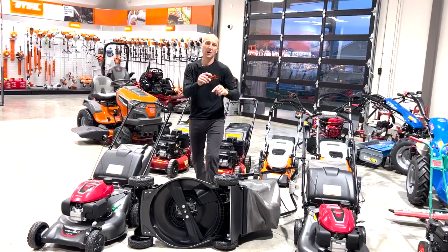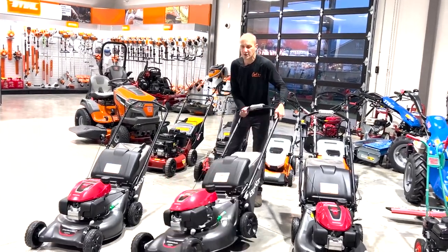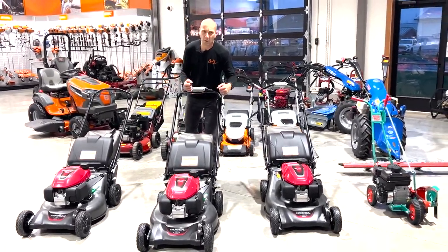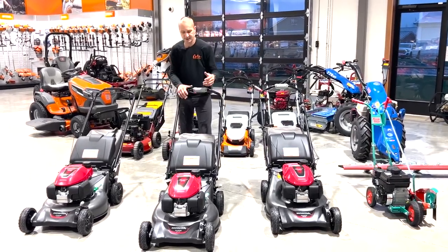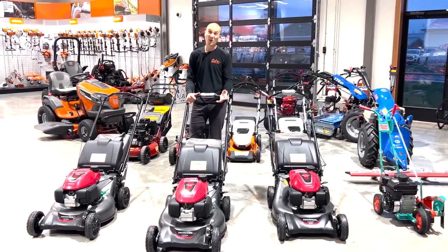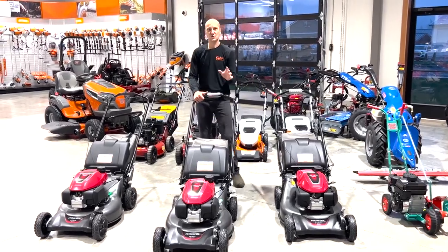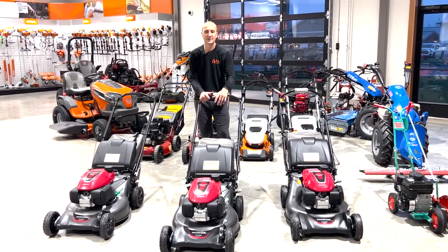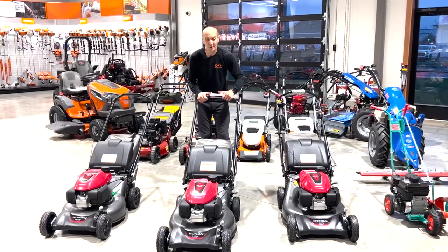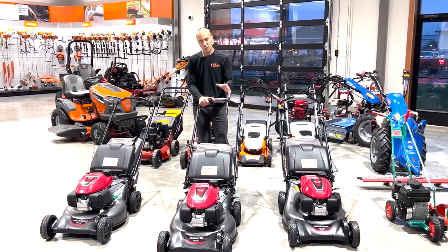We'll get to the coating in a little bit. The mower deck is clean — let's flip it down and pull it onto a clean, dry surface. I don't want to fire it up on that load of grass I just had there. Hold the handle, pull the rope, and run this thing. Hopefully we're low on gas and can actually run it out of gas. This takes a little bit of foresight because we're hoping to put in aspen fuel, which gives you a super long stable shelf life so that it starts in the spring. So let's run it out of gas.